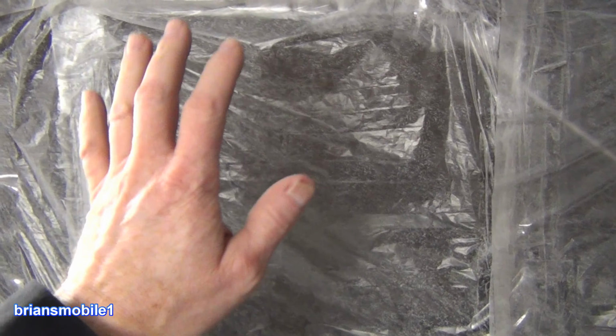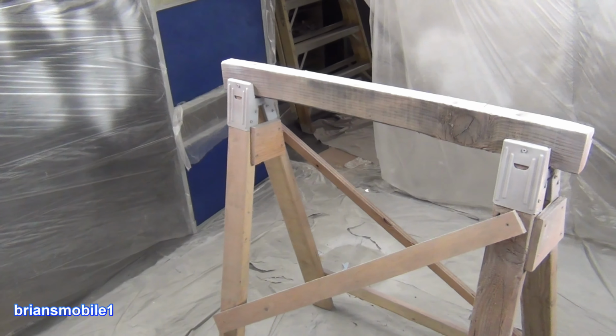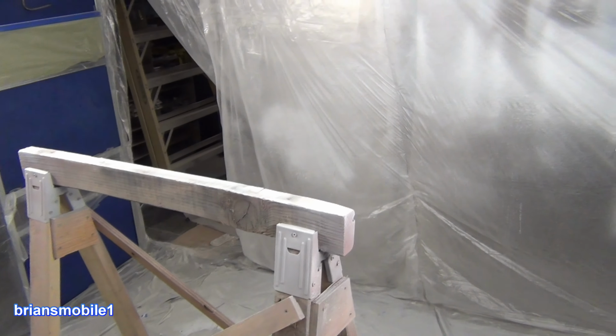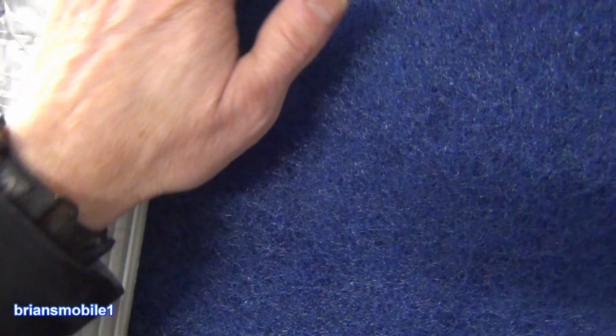The first version, the first two, well, I guess this would be the third version, but I did things in the side here, and I thought that if I had air coming in through here and out through there, it'd be great, but I didn't have enough volume of flow. And you have to have 0.5 meters per second, or 1.5 feet per second, of airflow so that everything gets ushered into the filter. This is double layered, and I'll show you how I made these.